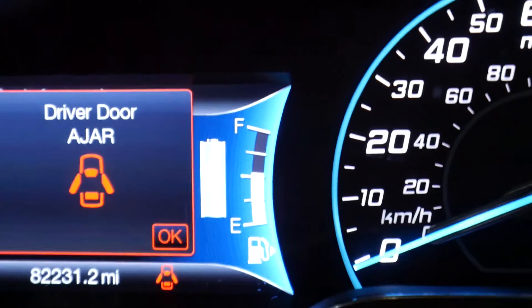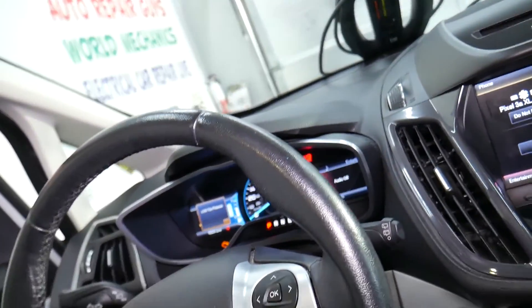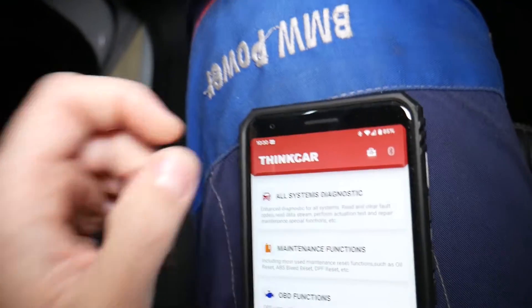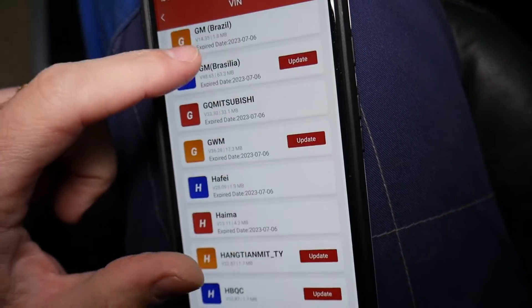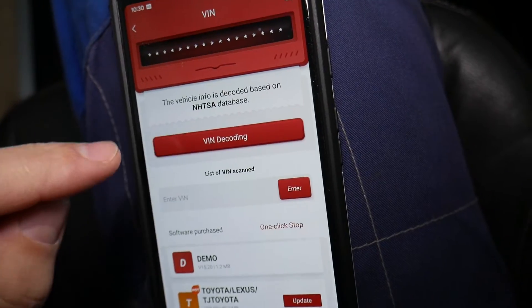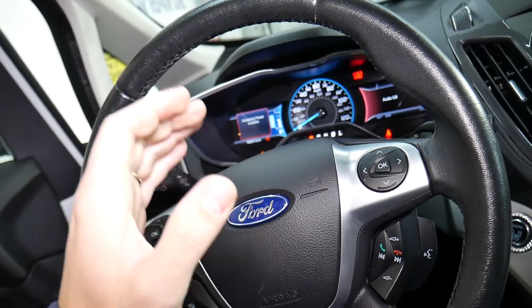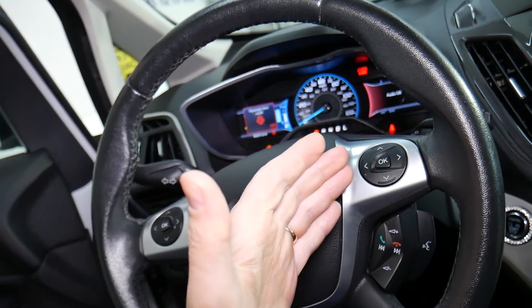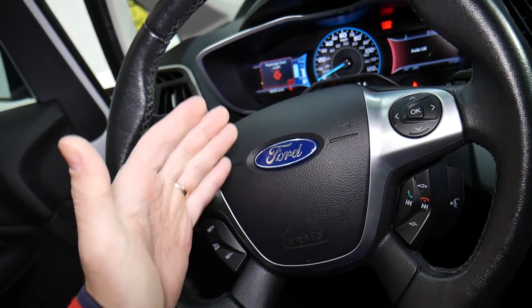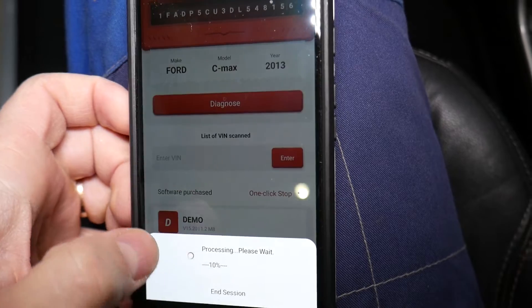Go ahead and plug it in. Turn the ignition switch on. In our case the battery is all the way full — we just finished charging it. I recommend testing the battery both when it's full and when it's almost empty. When it's full, you want to make sure all the cells charge all the way. When it's empty, you want to make sure all the cells discharge at about the same rate.